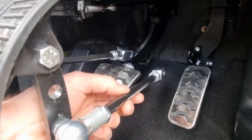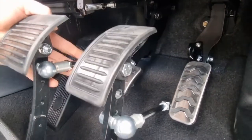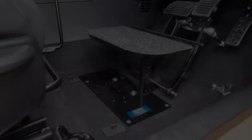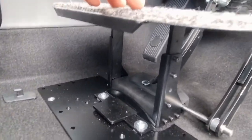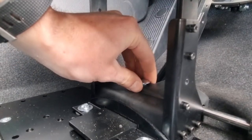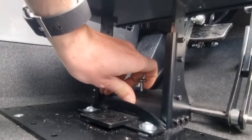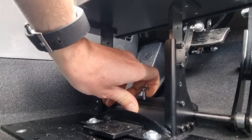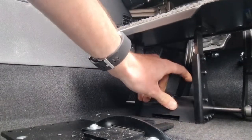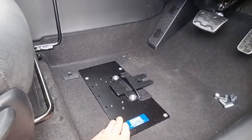At this point, angle the arms away from the pedals and out of the clevis — that gives you the forward motion to be able to remove the main unit itself. To remove the freestanding floor platform, there's a little pin; lift that up — it's spring-loaded — then wiggle the platform forwards, which can be a little stiff. The base can then be removed from the vehicle, leaving the mounting plate fixed to the vehicle itself.